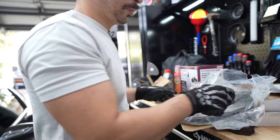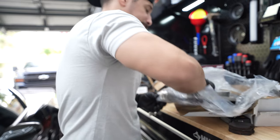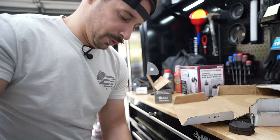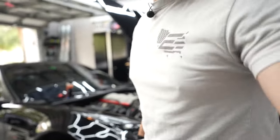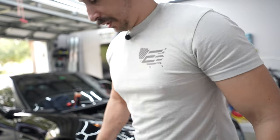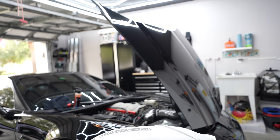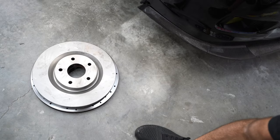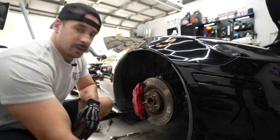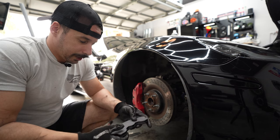KNS does have a good blank face rotor as well, but they were a little higher than the price point I wanted — about $110 a unit — and Napa had them on special for around $70. I've been spending so much on this car that I went with the Napa unit. I have a buddy with a fifth-gen Camaro who runs these Napas with DTC 70s and his car is an absolute unit, so I do trust them. Then — here's a problem — I noticed they are not the same size as the factory rotors.